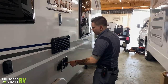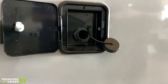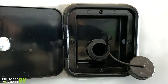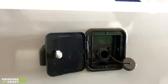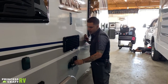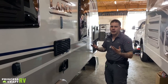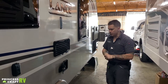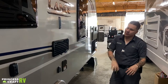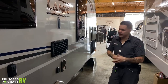We have your potable water fill down below here — that's how we fill that onboard holding tank. If we're doing any dry camping or going off-grid, we're going to use that holding tank. You're going to stick a drinking water hose directly into that orifice and fill it up until it overflows. Once you're full, go ahead and cap it off. You do need to use that onboard 12-volt water pump to draw that water up to the fixture and make it usable. We'll get to the location of that switch on the inside — it's also going to be run through the command center.